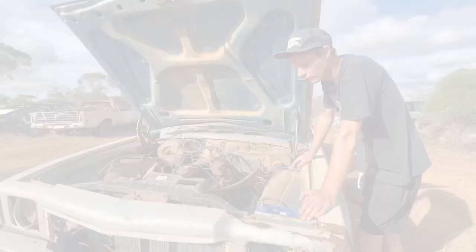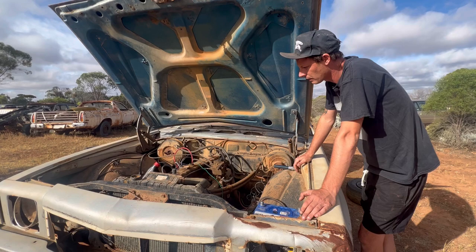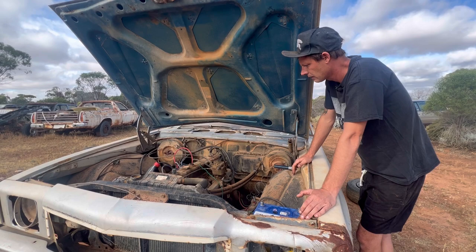Alright, that last bit was a bit dramatic. I managed to come back out when the rain wasn't as heavy and tightened up that nut on the starter, gave it a couple of cracks with a hammer, keyed it over and found out the fuel pump was working - very happy about that. After that when I could get fuel to the carb I noticed the pump in the carb wasn't pumping fuel, so I swapped that over and now we've got another carb on it, the proper carb.